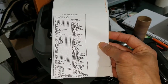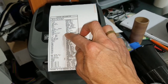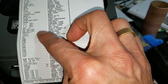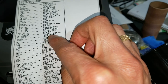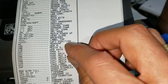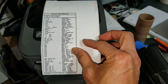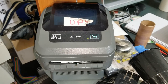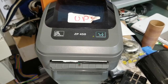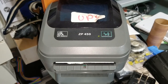printer, your Zebra printer. And you want to go ahead and look at the, let's see, the no motion. Make sure it says no motion on the media power up or no motion on the head close. Okay, so I already modified it, and right now I'm going to show you guys how to modify that. This only applies to Windows PC, not for Android or iPhone devices.